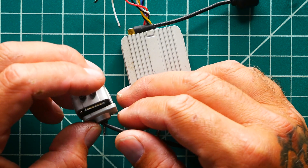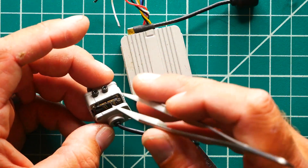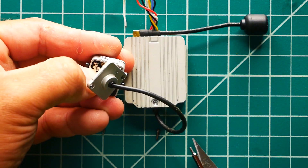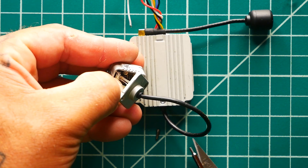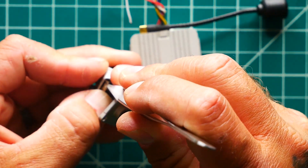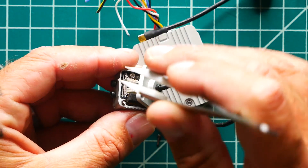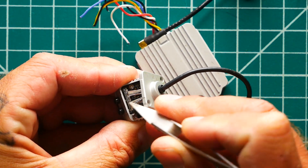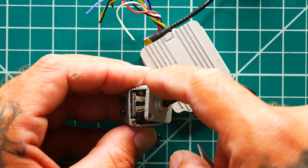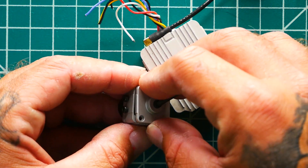The next thing we need to do is get this ribbon cable back installed. It's a very meticulous thing to do and you can break it, so be careful — you break it, you buy it. I've lined it up and held it with my thumb. After you've done that, you're just going to give it a push into place. You should hear it click. Then double-press everywhere to confirm. There you go — my ribbon cable is back connected. Make sure your connector is to the left and your arrow goes up, then go ahead and put the back plate back on.